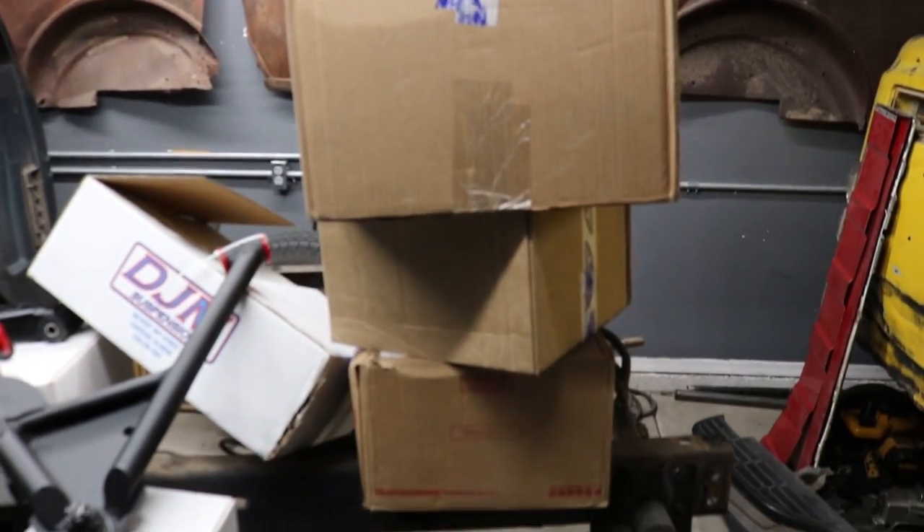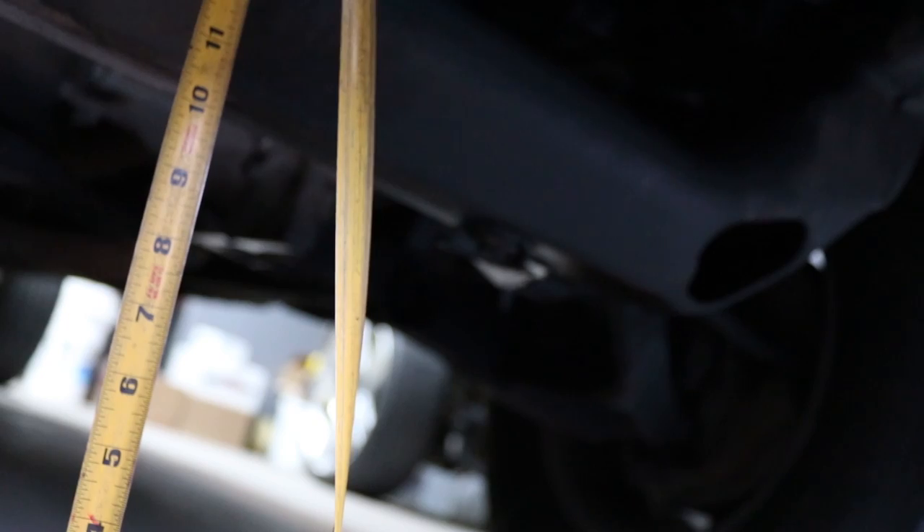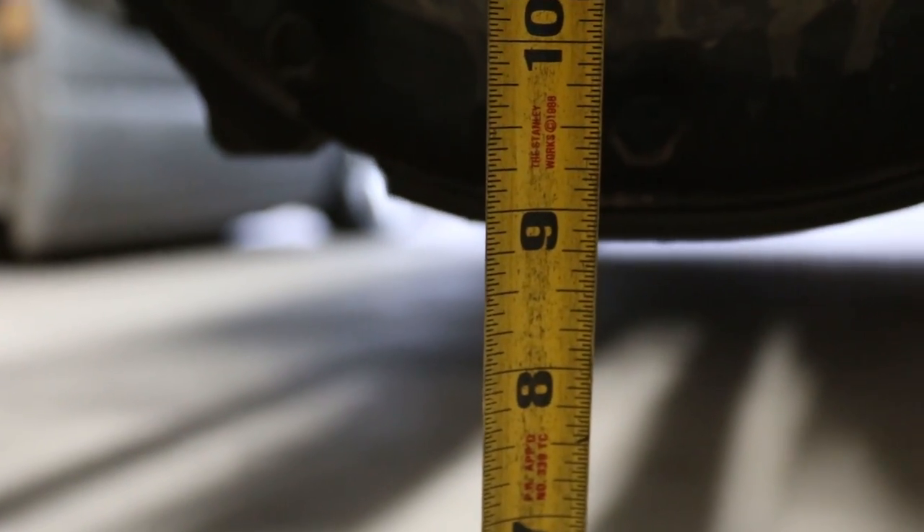So I went out and bought brand new upper A-arms. I got three-inch lower A-arms, meaning they dropped the truck three inches. I got drop spindles. I have a rear axle flip kit, and I got two-inch rear drop shackles. So total, it looks like we're going to be close to five in the front with an eight in the rear. Being that these are torsion bars, we could probably go lower or a little bit higher — I don't have to put the drop shackles on. I'm showing a height comparison on the front crossmember, the lowest point on the chassis in the front, and we'll come up with a number on how low this thing actually went. Here's the rear — the lowest point would be the pumpkin.